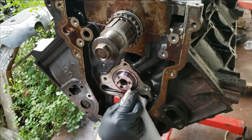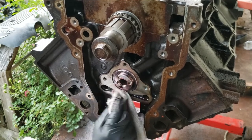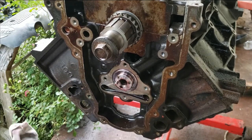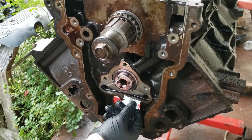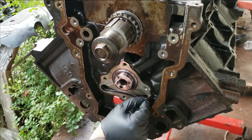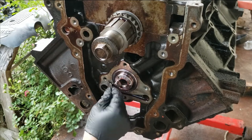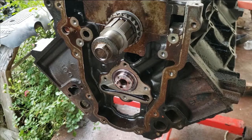You can spray this off, but I'm just going to take a rag and wipe this clean. Then I'm going to take a razor blade and scrape where that old one was sitting. Lightly scrape — you do not want to gash this because you will lose oil pressure. Just lightly scrape and get all the old gunk and oil off of it.